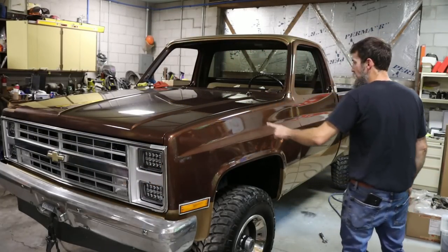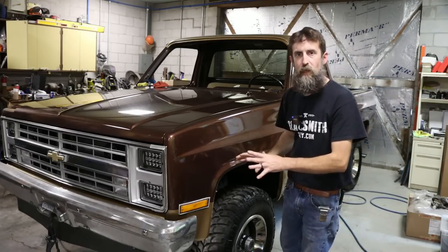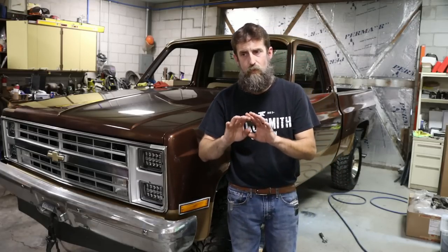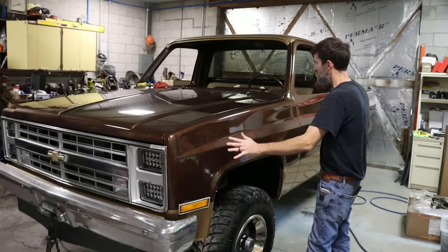These old Chevy pickup trucks were pretty bad at rusting, and that area is about the size of the truck. Now that I've got this thing painted, I want to make sure it stays nice as long as possible. You don't want to apply any oils if you're going to be doing body work soon, because it will mess with your paint, primer, and cause your materials not to stick. But keep in mind — you do not have to buy FluidFilm. You can use used motor oil, gear oil, bar oil from a chainsaw, or diesel fuel. All these products are going to work. This stuff was highly recommended, I wanted to try it, and supposedly it sticks around for a very long time.